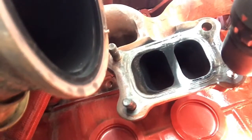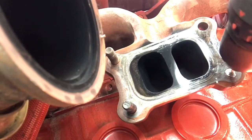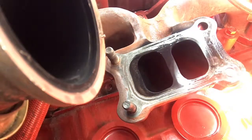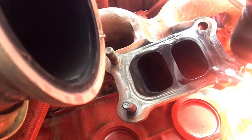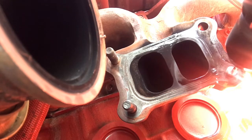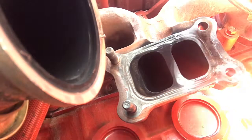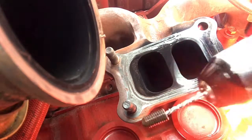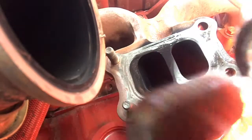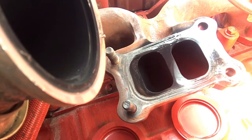It's gonna come out more and even better each time. When you put your extractor in, you want it to go all the way through as far as you can. Oh, here we go — this one is coming out on its own with just the left-hand drill bit. There it goes — got it out! Now sometimes you need an extractor, sometimes you don't — it just depends. So that's the broken stud out.